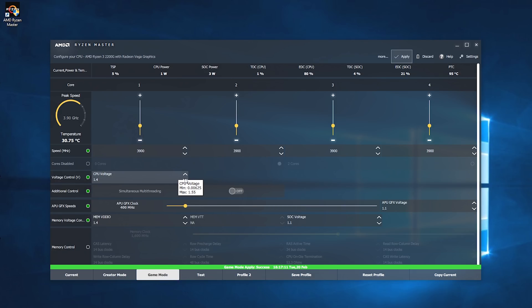While increasing the CPU core frequency, you'll also want to increase the CPU voltage. The Ryzen Master software does default to 1.4 V for some reason, and this is already very high — I wouldn't recommend pushing much higher for 24/7 use. In fact, you could try dialing it back a bit. Somewhere between 1.3 and 1.4 V is likely where you'll end up.